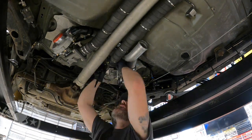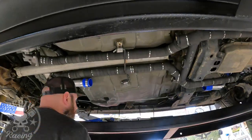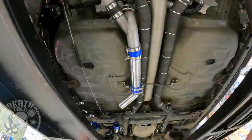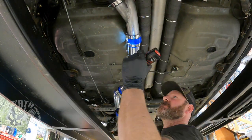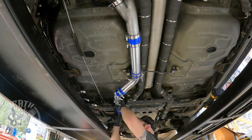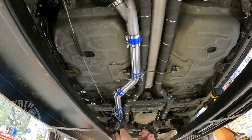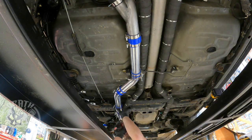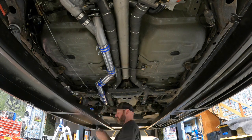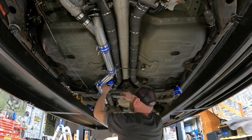Now I'm permanently installing all the charge line. Remember we had those little tabs on the side of the exhaust that we're going to hang this by with a normal hose clamp, not a turbo clamp. When you're cutting these pieces together you're going to have to flange everywhere you're putting a clamp, or they will pop off — you can't tighten them tight enough without some sort of a barb on the end of the tube. I'm using my pipe expander for the exhaust, being really careful because you can barely feel the resistance when opening up aluminum.